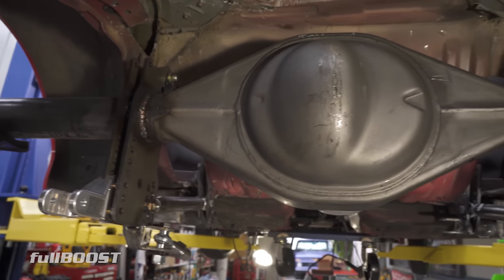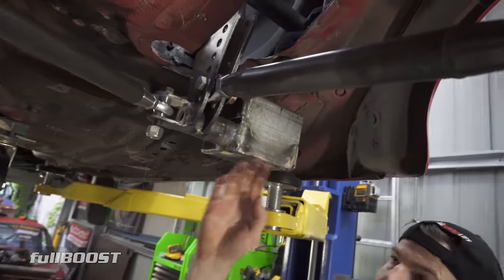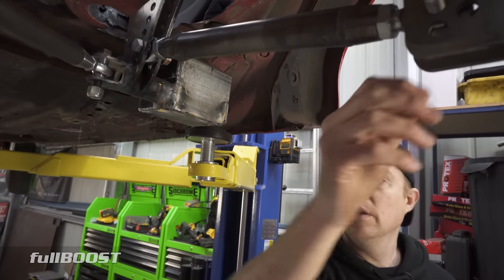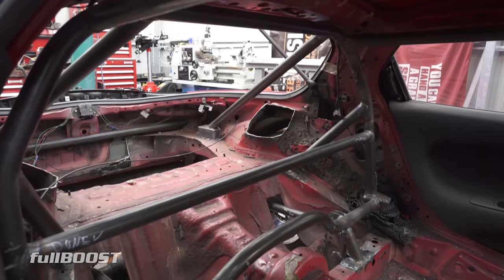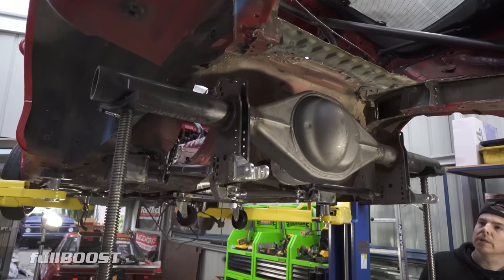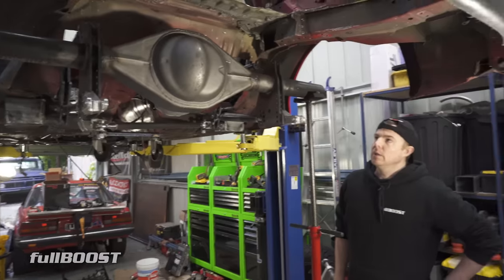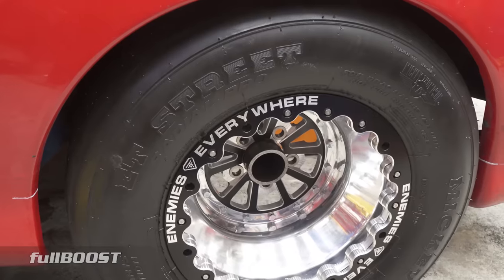The rear mounts are now in place — boxed in with chrome moly tube that runs through and is welded all the way around, welded in here twice, boxed on the end as well, and reinforced up inside the car too. Big chunky plates, big eyelets, and chrome moly rod ends and rods. The Pro 9 kit makes the job super easy. That's pretty much it for the diff at the moment. Hopefully we get the shocks on soon — they're going to be something pretty trick that a lot of drag racers probably haven't used much. We're working with an Australian company to develop something that hopefully Australian and international drag racers will really enjoy going forward.